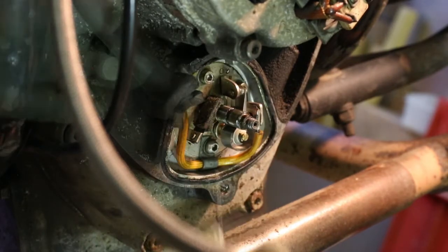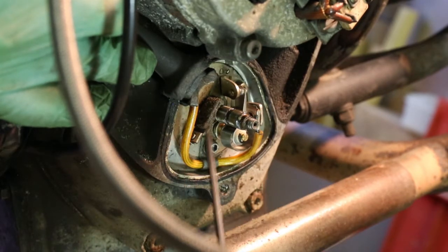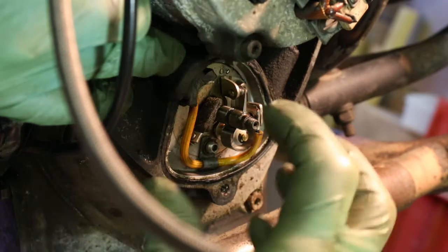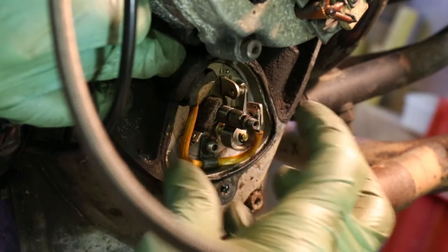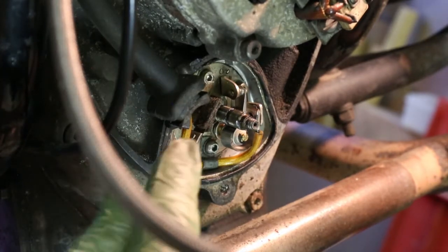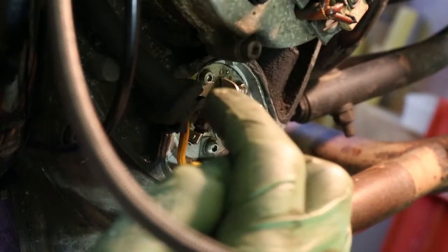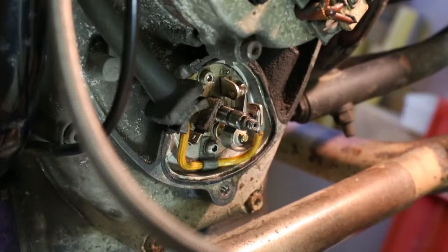Now I said I'd tell you what this tube is for. You'll notice there's a rubber seal all the way around the points here — that makes a little enclosure, and this tube is in line with that seal. The housing has a little enclosure which comes down and touches this seal all the way around, putting the points in a little waterproof container. On the side of the front panel there are airways, and those allow air to rush in to cool the alternator and the diode pack.